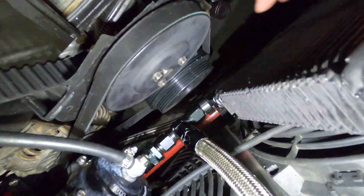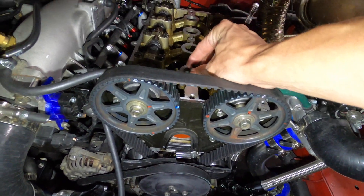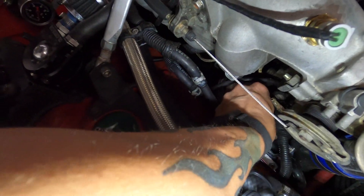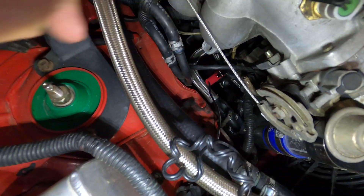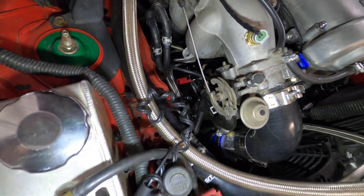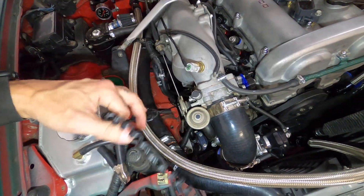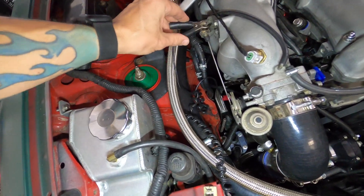You can see I have that set at top dead center — that's going to be this first mark right here. I do have the spark plug out, but there's really no reason to show you. You could easily just put something in here, wiggle it around, and you would see it's at top dead center. So all that's left to do is reassemble the engine, start it back up, and set the base timing. To save some talking over the engine while it's running, I'm going to show you how to hook up the timing light. It's right down here on the alternator positive. Make sure you're not touching anything else — I have my oil line right there for my cooler relocation kit and I don't want that grounding out, since it's all metal.